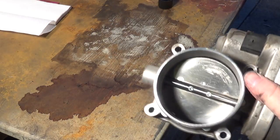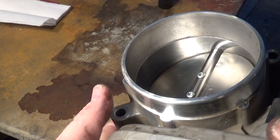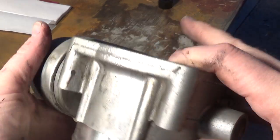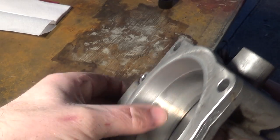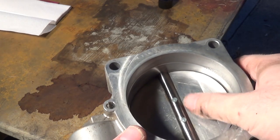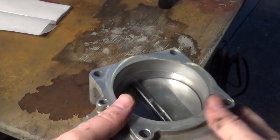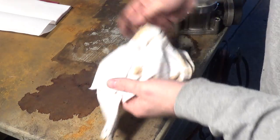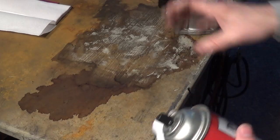After about 15 to 20 minutes working on this — here's the front side, which was always pretty clean, just a little bit cleaner now. And here's the back side, towards the intake manifold — all of that is nice and clean now. It was really caked up here on the sides. The carbon came off the back of the butterfly valve pretty easily, but down here I had to scrub it. I'm going to wet down this rag — this stuff is actually pretty caustic, it took some paint off my table — and reach into the intake manifold as far as I can to clean some of that out before putting this back on.